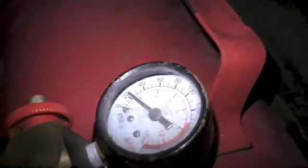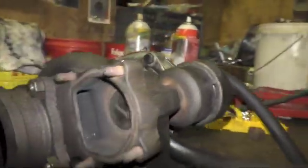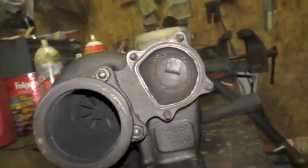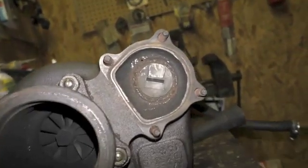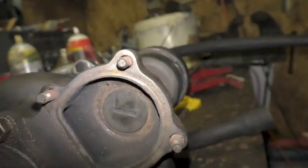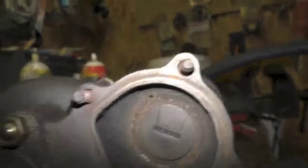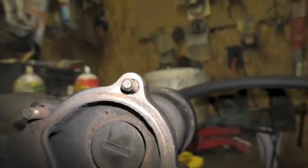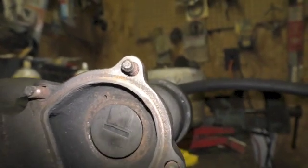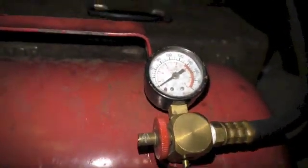Can you see - just over 20 PSI - I'm going to activate this valve, charge the line with the spray nozzle, and watch the wastegate. Holding this with one hand, activating with the other at just over 20 PSI - here we go. Wide open, very nice! But what I'm finding is that if I let the pressure go down, it opens less and less as you'd expect. The question is what does it do when the pressure gets down close to 11 PSI? Right now in the tank we're still over 15, so let me run some pressure out.